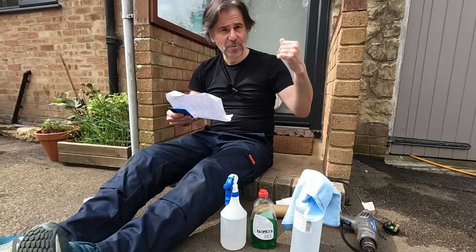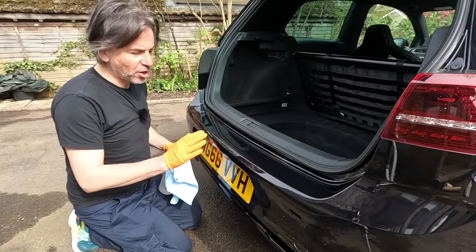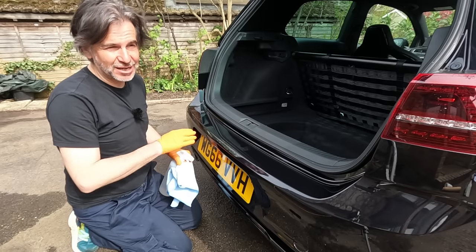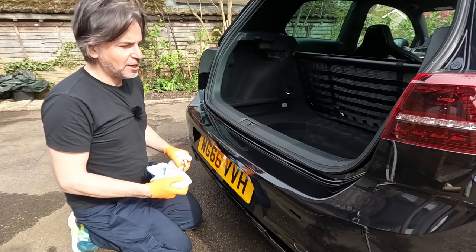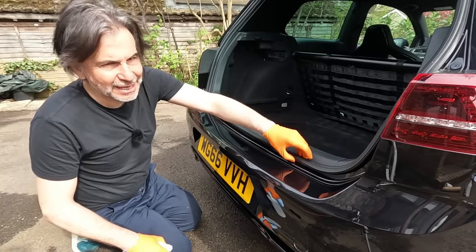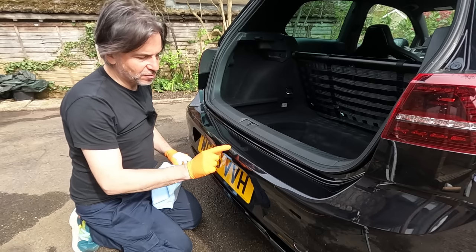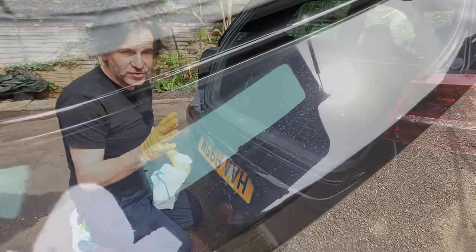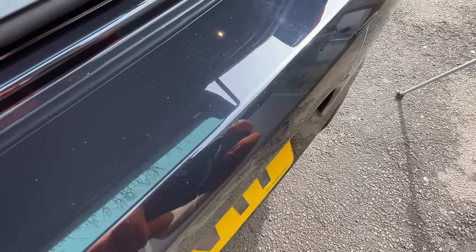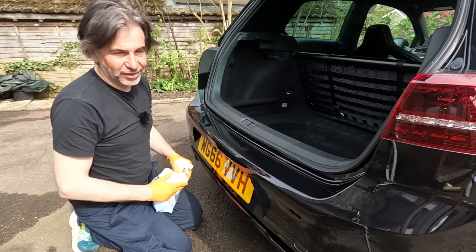Let's start by preparing the panel. As with a lot of things, preparation is key. You need to make sure there's no wax on the surface where the PPF is going, that if it's fresh paint you've left it three weeks to properly dry, and that the surface is dry — I washed it today so I'll just check under the seal for water. When I got this car it had a few little marks on the bumper; I polished them back and the surface is quite smooth. The PPF should protect the bumper and also make it look better.